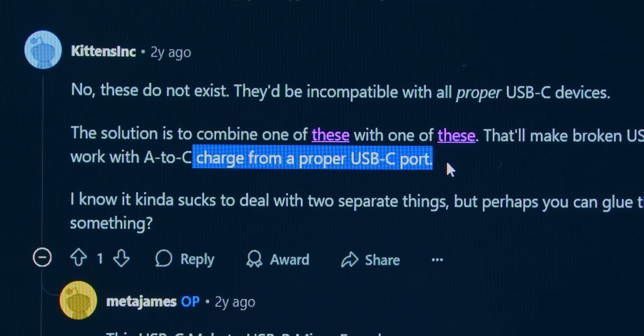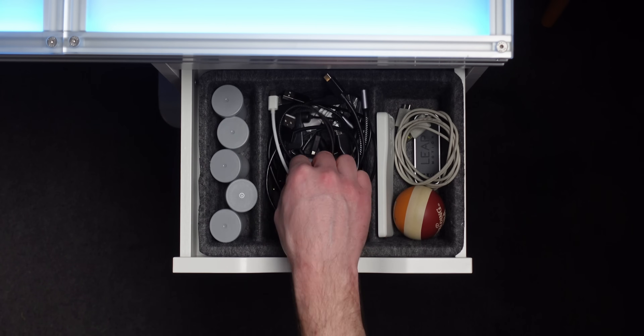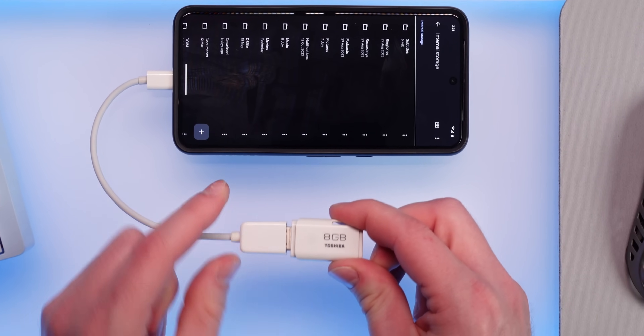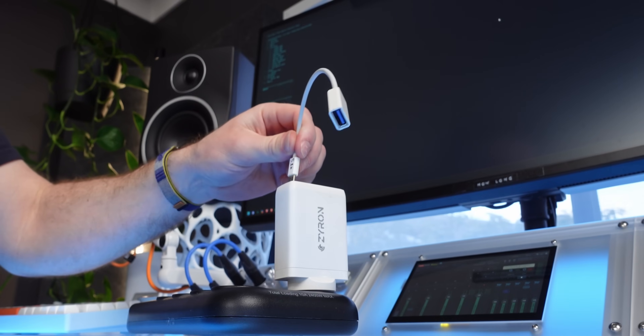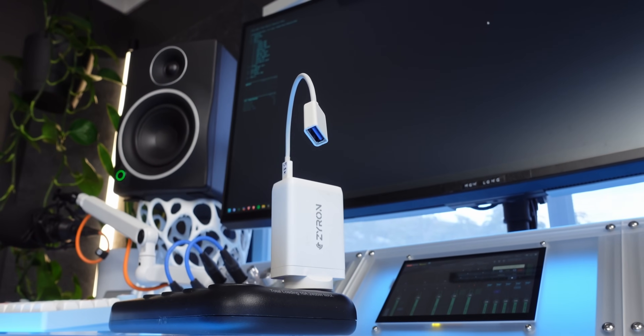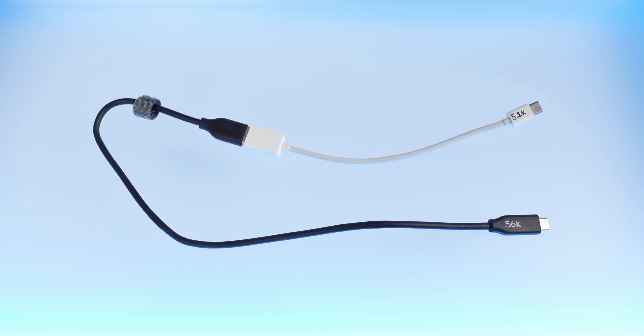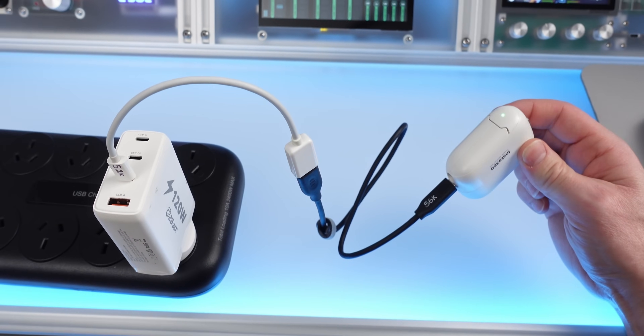This has haunted me for years. I've only bought power supplies and power banks with Type-A ports for devices that don't charge properly over USB Type-C. And now you're telling me that Cable Combo 2 has been in my drawer this whole time? I read this tip in a Reddit post, and the thread also pointed out the same goes for what's known as a legacy adapter — the ones for plugging a USB key into a USB-C phone. I never considered plugging one into a charger. Sure enough, when combined with a USB-A to C cable, this has the same resistor combo and it just charges.